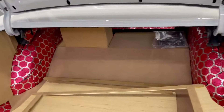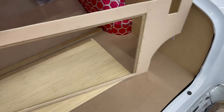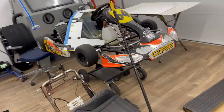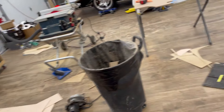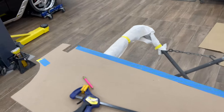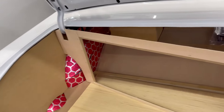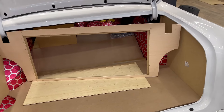One obvious screw-up: this back panel — I think this is the third one I've made. I templated everything using plastic cardboard sign material hot-glued together. Originally I made it out of half-inch MDF thinking I needed it stronger, but it stood out proud and needed to be thinner to tuck back in with a little flex. Lesson learned: make it out of thin material.